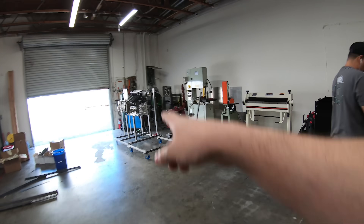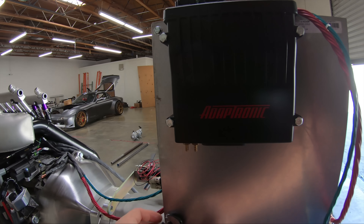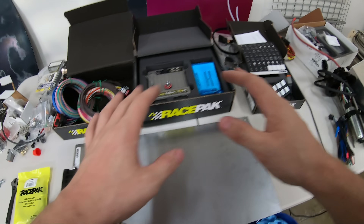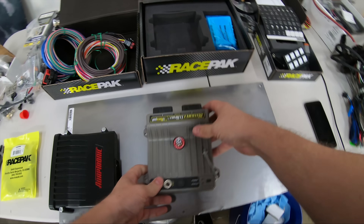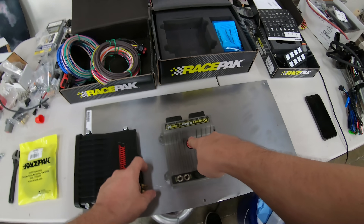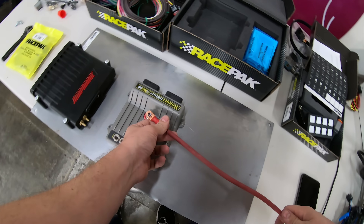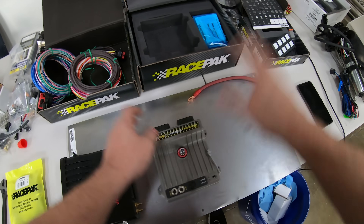While Isaiah goes and works on adding the extra pole for the oil system, I'm going to take off my metal plate meant for all the electronics so I can work on that separately. I had to clean this up because it's just getting gnarly — it is getting nuts how much stuff we're trying to manage all at once. This is the PDM. I suspect I'll probably have all the cables going towards the back of the engine — I just want them away from heat. We will have the battery plugged right into this. The battery will be on the ground on the base of the engine stand. This will be the distribution point for any other electronics, not the starter. The starter will have its own line because that's just nuts.